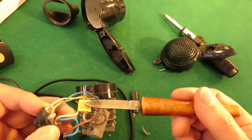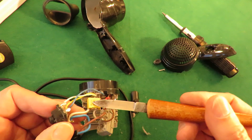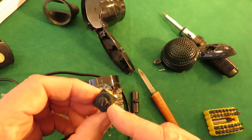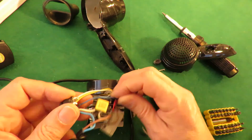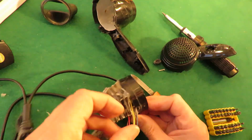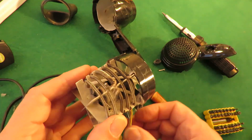Big Clive will explain to you what that capacitor's for, and that little resistor there which will drop the power — let the power go from that capacitor after it's been switched off. And that bit switches between 120 and 230 volts. I should think that's just a matter of how much of the heater element is in use.